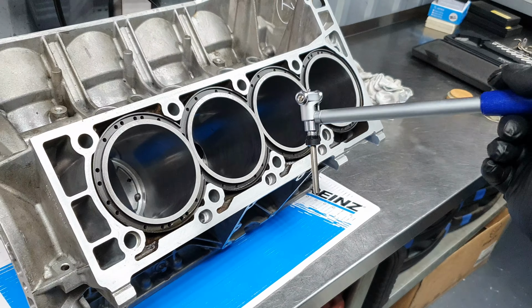So you're gonna say, okay, screw it, I'm gonna put 8 new pistons. You're gonna spend money to buy 8 new pistons to put them in a cylinder that has a tenth of a millimeter run out. That's like an egg. It doesn't make any sense. You're not bothering with that.